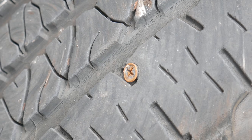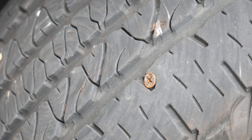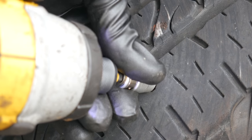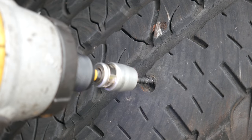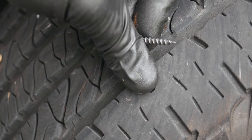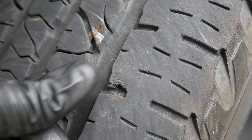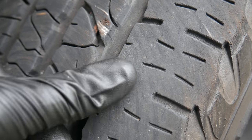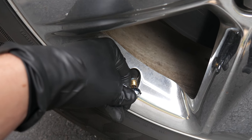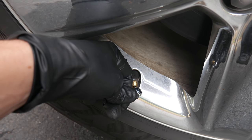The next thing we have to do is remove the object that has punctured the tire. In this case, the head of the screw was there and not ground off, so it was extremely easy. But a lot of the time you will not be so lucky — pliers, vice grips, and channel locks are definitely your friend here. As soon as our foreign object is removed, you can hear that there is now a lot of air escaping. To accelerate this, we could hold open the tire valve stem until it is totally empty, or an even faster way is to totally remove the core from the valve stem.